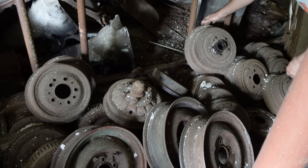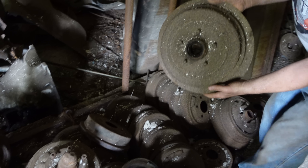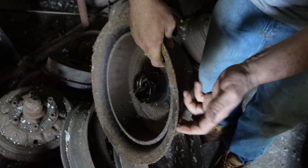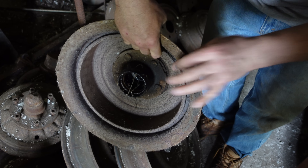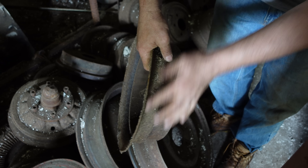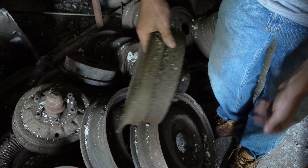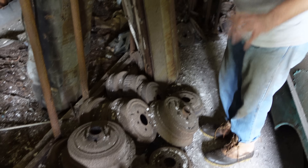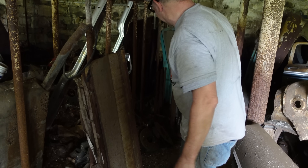Full-sized Oldsmobile right here — up front, massive drum, but with this weird hat. What's up with that? Well, this actually is a heat sink that would live outside the rim. The tire would be here. This is out in the airstream where cooling air would blow past it and help to dissipate the heat. Drum brakes — not just one size fits all. There's all kinds.